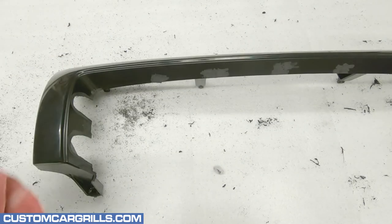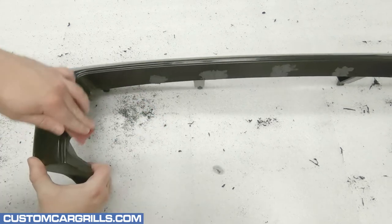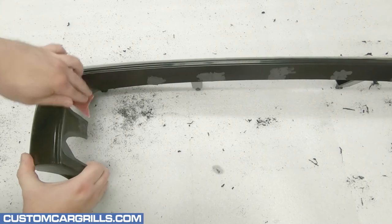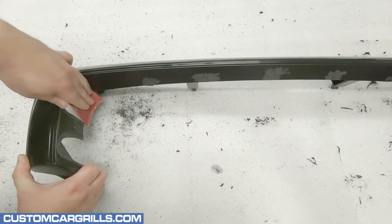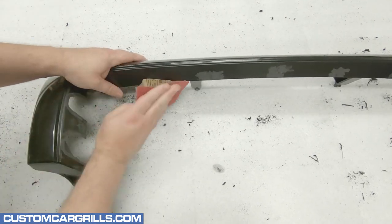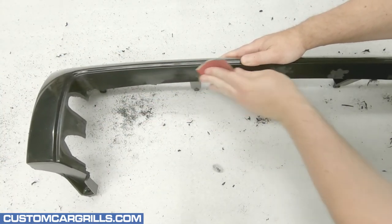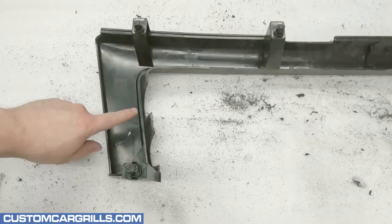To refine this down a little further, I'm going to grab some coarse grit sandpaper. At this point, I'm not removing a whole lot of material except for a little bit of unevenness left from the cuts. If too much plastic is sanded out, then the edge walls become too thin, especially on the top edge.